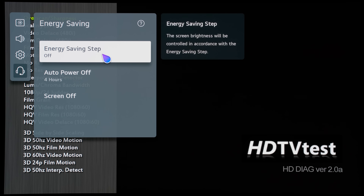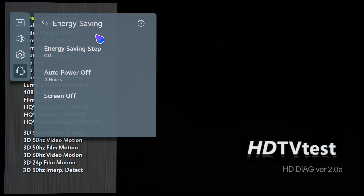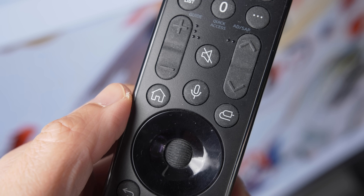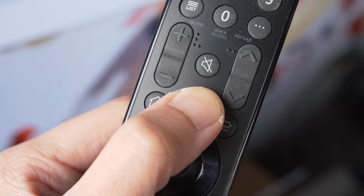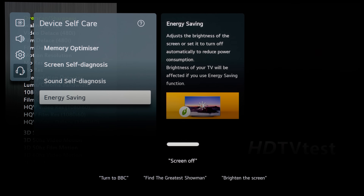But more importantly, for some of you, maybe you are listening to music on your LG TV and you want to switch off the screen. The screen off function is actually located under the energy saving submenu, and it can be a struggle to navigate through so many layers to get there. So one tip I have for you is that you can long press the voice assistant button on the LG Magic Remote and say 'screen off.' This will turn off the screen — let me demonstrate. Screen off. And this is much quicker than having to manually navigate through so many layers of the user menu just to get to the screen off option.